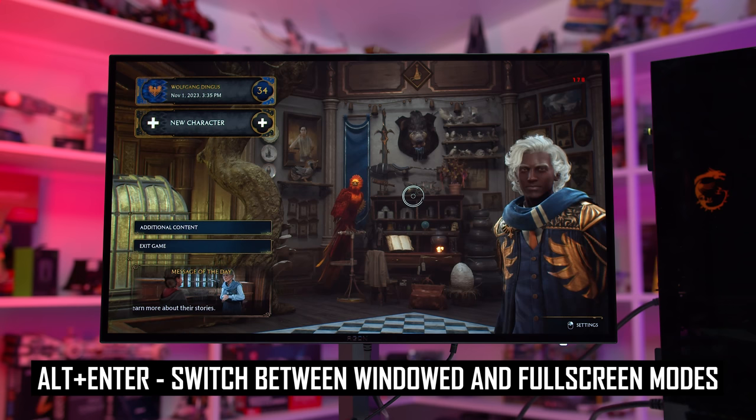There are a few other general monitor setup tips and tricks worth knowing. Monitors have both a warm-up time and a settling time before they reach optimal performance. If you are experiencing more backlight bleed or IPS glow than you are satisfied with, it's possible you will see small improvements over the course of one to two weeks after taking your new monitor out of the packaging. This is because the manufacturing and packaging process can slightly compress the display's layers and materials, which slowly expand and settle back to a normal state after the monitor is set up.